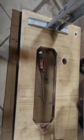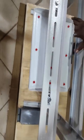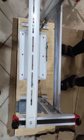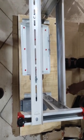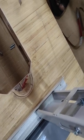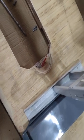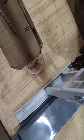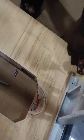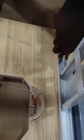Now you use your star screwdriver, and make sure that the greater weight of the machine is centralized at the foot of the machine, right? Then tighten it. So you might just measure 4 inches off from the back part of the machine, 4 inches off from here, or 5 inches off from here, and then maybe 2 inches or 1.5 inch off from the front is recommended. Then you fix it at that particular position. So you make sure you tighten it and make sure it's centralized. Then I will tighten this and now show you the results.